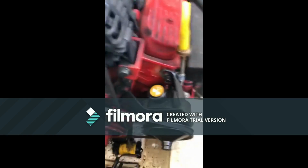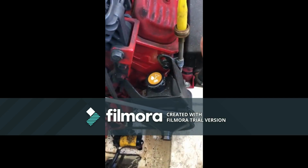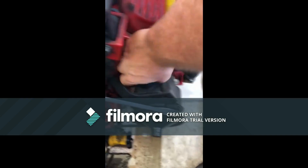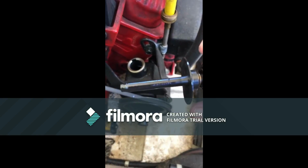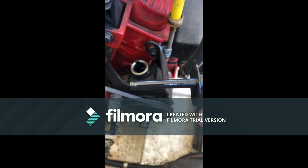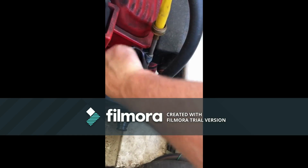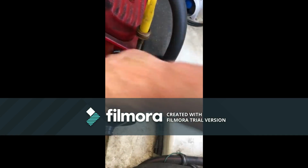Okay, yesterday I checked the power steering fluid. It was completely dry. I added about a half a quart to it, and it's kind of hard to see, but it's showing about halfway between the cold and the hot mark on there. So I think we're good on fluid. So next I'm gonna start the motor and let it run and turn the steering back and forth.